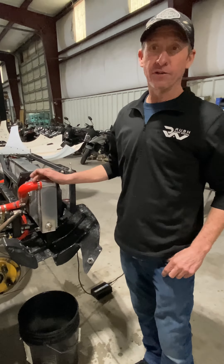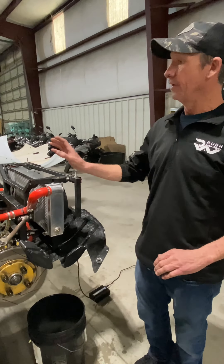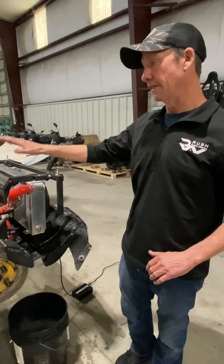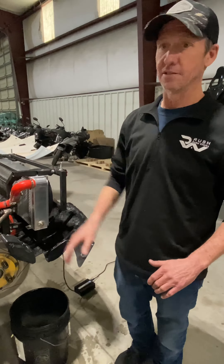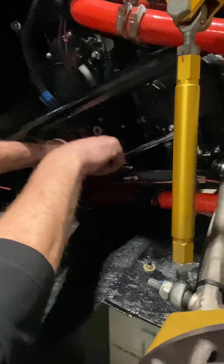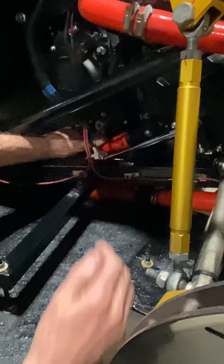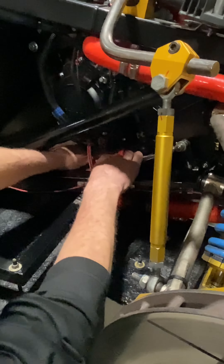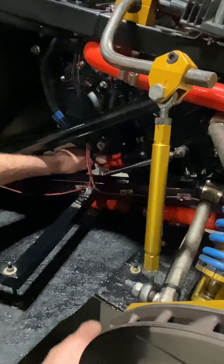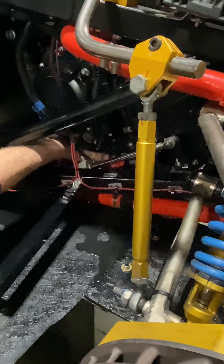Now that the radiator's drained completely, I can go ahead and move over to getting the bottom radiator line off the engine itself, and that will get the remaining amount of water that's in the engine and cooling system out, as it's the lowest point on the car. I've already got the clamp loose, but basically we're just going to remove this hose. You want to have a drain pan underneath here — you're going to get a little bit of water. As you take this off, kind of angle it inboard and that'll aim it towards your drain pan so you won't get so much on the floorboard of the car.